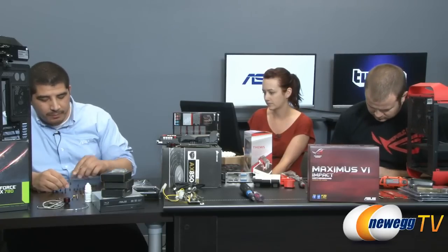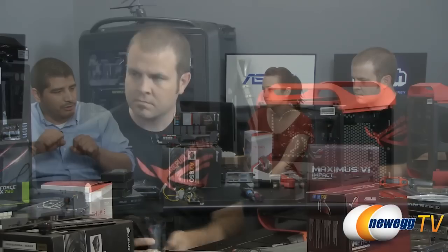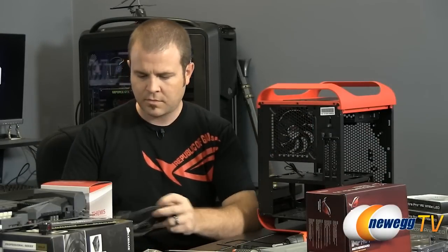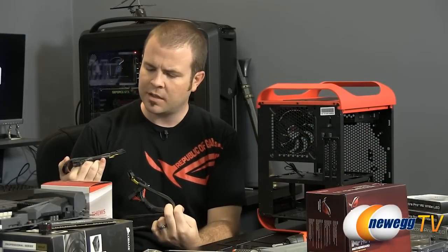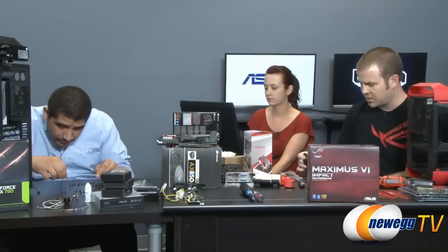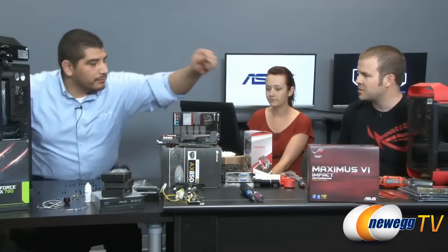The times that I've seen it leaking most is when people get a little bit aggressive bending the actual cabling and the preset tubing, and sometimes they'll cause a little bit of flex or tearing, and that's where the leaking ends up occurring, but not because it's inherently an unreliable design. Yeah, check your cooler out of the box. If there's no leaking right then, chances are you'll be fine. But it always helps to reality check from time to time.